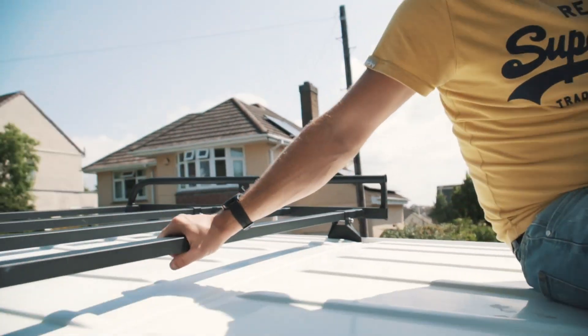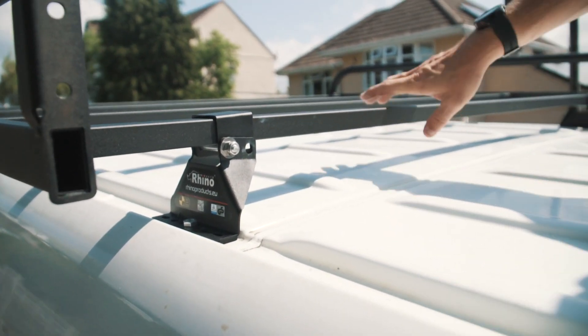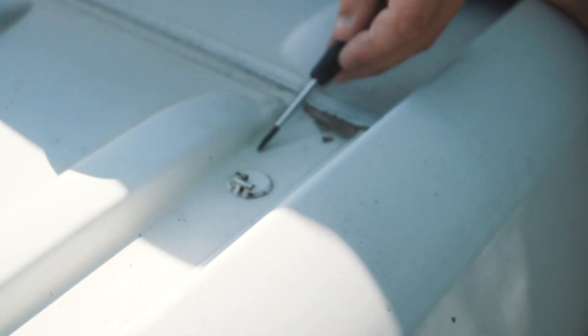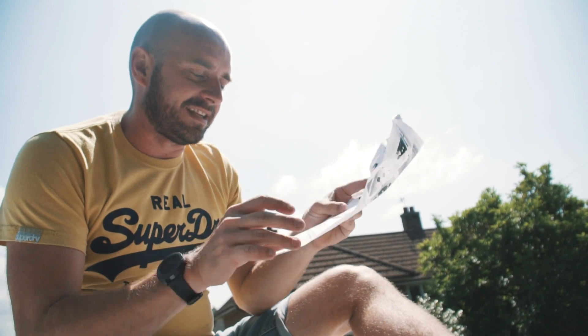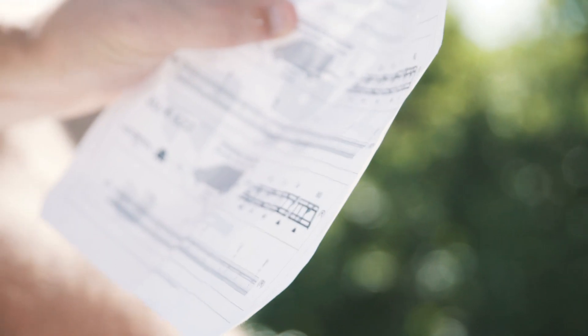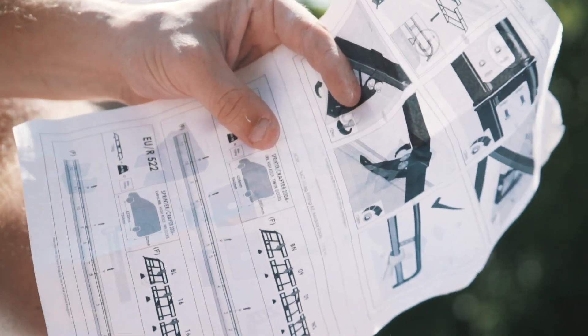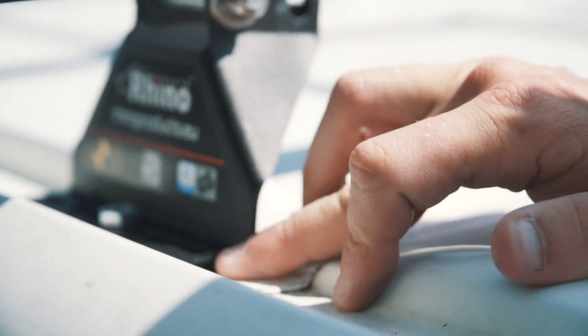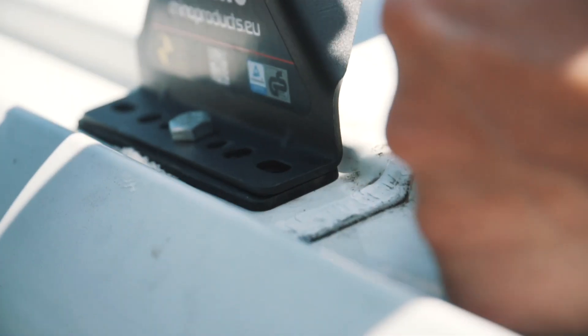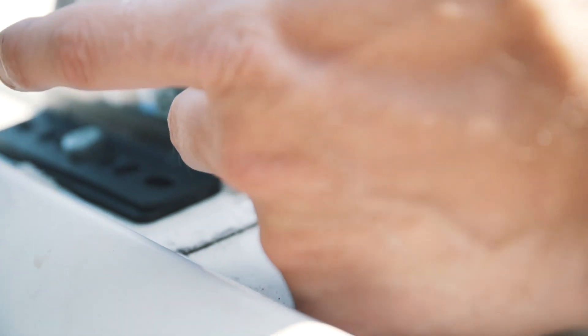We did this one yesterday just to get an idea of how it fits. I've got four more pieces to fit today. The instructions tell you which spots to take out and that's where we fit these brackets. We bolt them down through - they've got a little pad to keep it nice and watertight, with a pad on top and underneath so when the bolt comes through it clamps together. We've also added a bead of Sikaflex around the hole to make it even more watertight.